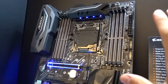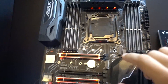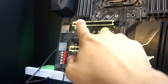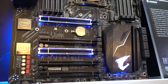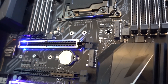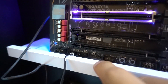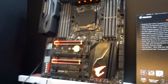That being said, you still get some really nice base features here. Obviously you get quad-channel memory support, support for the latest Skylake X and Kaby Lake X processors. Five PCIe Gen 3 slots right there, especially these two nice little reinforced ones with the LEDs — that's kind of a nice touch. Nice little LED on the chipset heatsink as well. And in the middle of the motherboard, we get a pair of M.2 NVMe SSD slots right there, which we're going to talk more about in a little bit. And down here there's a digital LED header.